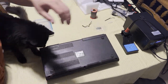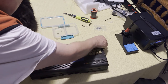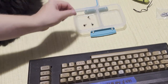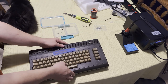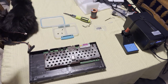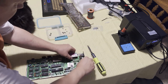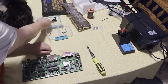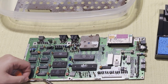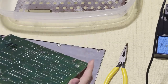While the thing was warming up, I've got to take this thing apart. Let's get those case screws into a container so that we don't lose them. The case screws are rusted — we'll show you one up close in just a bit. The C16 comes apart much like a VIC-20. There are hinges on the back, and then the case screws are all three on the front there. The keyboard is not compatible with the VIC-20, so don't try to use a VIC-20 keyboard in here. Let's get that horrible RF shield off of there.